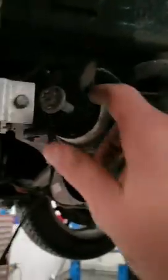Now we want to remove the bolt that holds the lower control arm in place. I like to lubricate that bolt so that it releases easier. Using the 18mm socket, loosen the lower control arm. Not enough room — we have to remove this front lower control arm as well, also with an 18mm socket. Simply remove the bolt. Now we've got plenty of space to work.